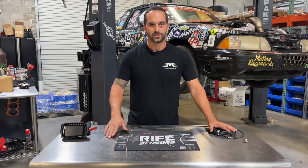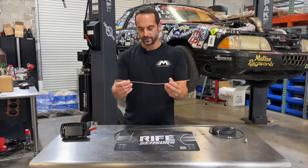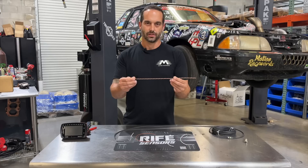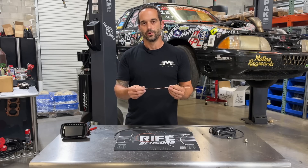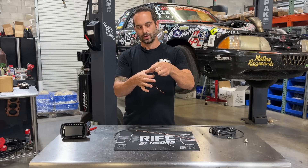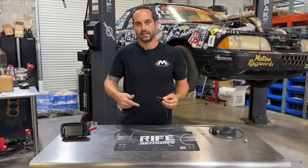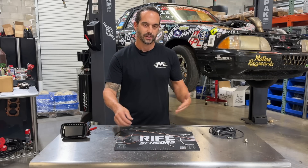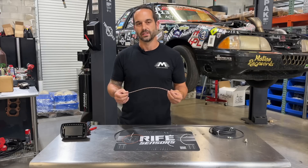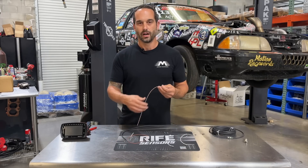An alternative to a shielded cable — as you've probably seen in communication systems like CAN, or if you've ever looked inside an ethernet cable — is a twisted pair wire. Inside the shielding the wires are twisted, but you may also see twisted pair wire without the outside shielding. Twisting the wires on the same circuit together will still decrease the amount of noise, because the current passing through the wire creates an electromagnetic loop around the wire. When you twist the wires, those loops become smaller and broken up, so they're less likely to transmit noise into adjacent wires. So if you have sensors on your harness — a MAP sensor, pressure sensor, or your CAN network — you can hand-twist your wires without necessarily needing shielded pair on every single set.